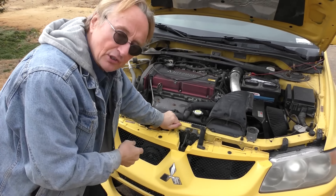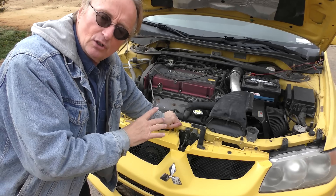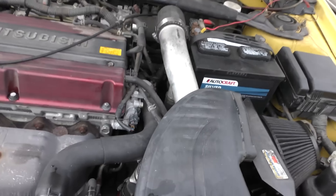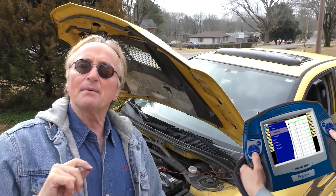I do have to applaud the engineers that made this little 2-liter put out 271 horsepower, but at the same time there's very little good diagnostic data on a stock car to figure out what goes wrong with the one that came from the factory. And when you start adding aftermarket stuff like cold air intakes, that's not factory — it didn't come with any of that. You're going to make attempted repairs at least three times as complex to diagnose and repair. In this case, the data on my computer is quite clear — any fool can see it's running rich: you can smell it, you saw my black wet finger, raw fuel in the exhaust, and my scan tool confirms the vehicle is running rich.